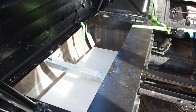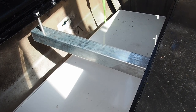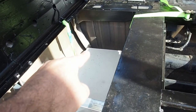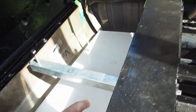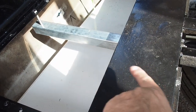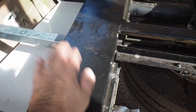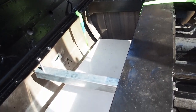I got under the bus yesterday afternoon to check how things would look with the tank, and I saw that there were two outlet points — one for drainage — where my support on the bottom left-hand side was, and that's exactly where my threaded rod would have come right in the middle. So I had to move it back this way. And on the other side the inlet for the black tank was coming right across where my other rod would have been, so I had to move that too. Do yourself a favour — once you get it ready, make sure you look underneath at the outlets, because they were covered by the supports and I didn't see them.